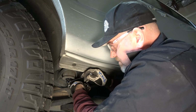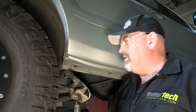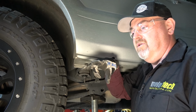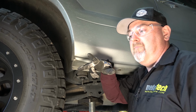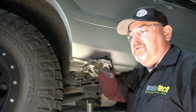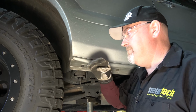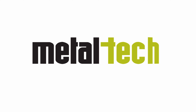One of the main reasons that we just did the one, but we released all 3 of these, is because we don't want to create an uneven tension on the body. So what we did by releasing the 2 in the back, those are free. The one on this side is free. And then we lifted this corner up by 1/4 of an inch. So these are just all of them lifted up a little bit, and we bolted them back down again. So now the truck's sitting with a smaller 1/4 inch shim adjustment on the back for the body to the frame, and everything's been snugged back up and we're done. Piece of cake. Thanks for watching us.